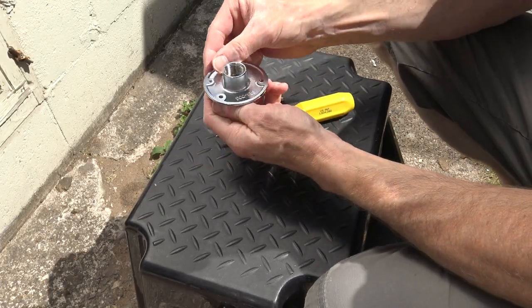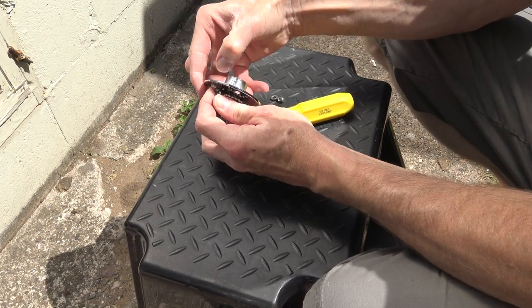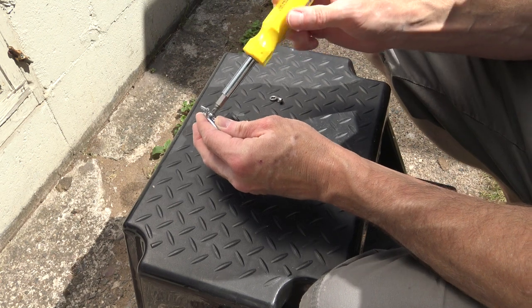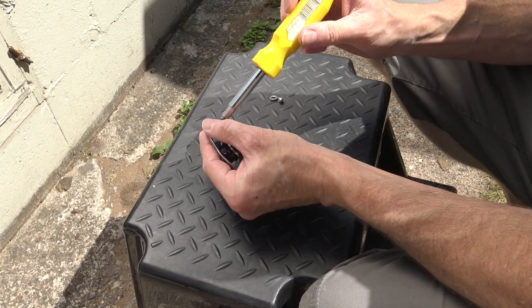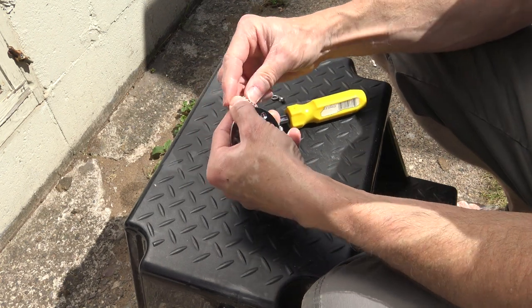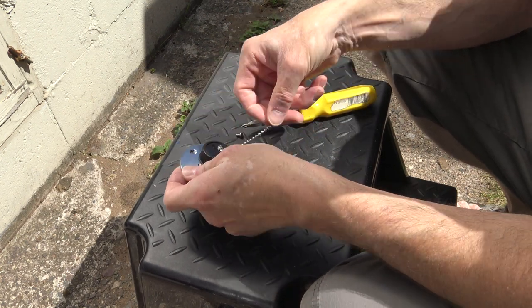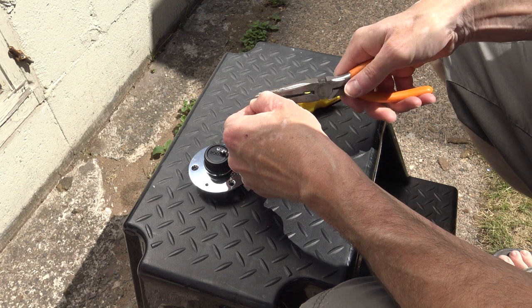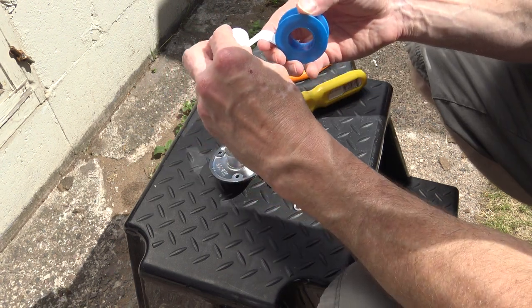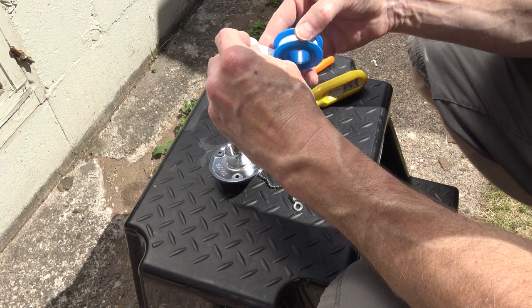I purchased a Sea Dog water outlet to be used as my sink's gray water drain. I didn't like how the retaining screw for the tether protruded out the back, preventing the outlet from sitting flush against the wall. I made a small modification in order to use one of the mounting screws as the anchor for the tether. A nylon barb adapter was then connected to the water outlet.